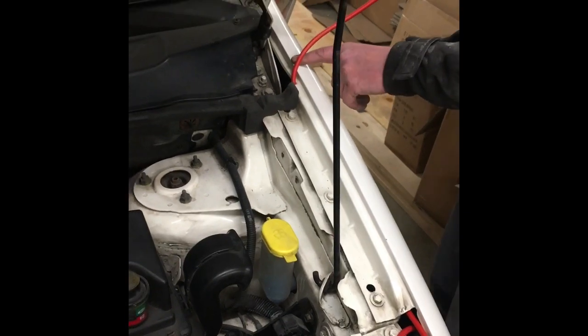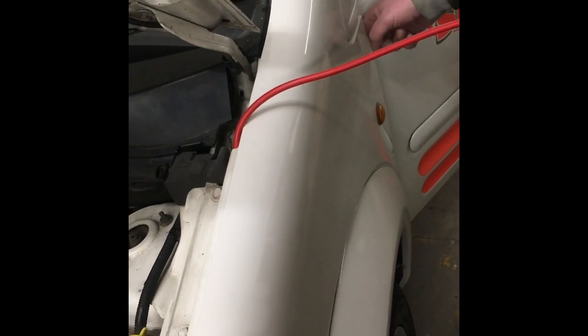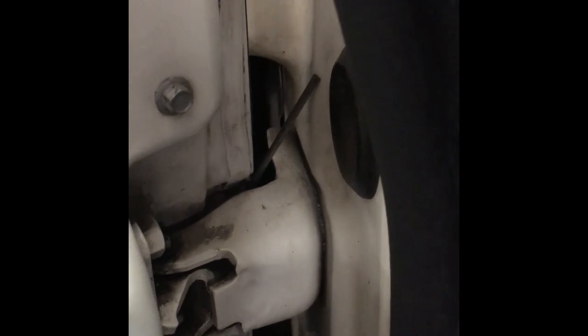After that, we're going to go from the wing down inside the back of the wing, and it will come out on the foam pad on the wing section. From there it goes down the A-pillar through a grommet into the vehicle — I will do another video on this part later. Now working from inside the van, where the A-pillar is at the top hinge, I've had to use some old-fashioned coat hanger wire — it's a bit stronger. I've pushed that through from outside the van, which now comes out at the top of the wing edge near the bonnet hinge.